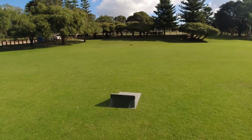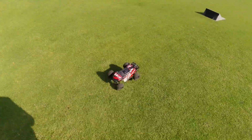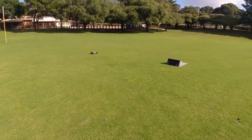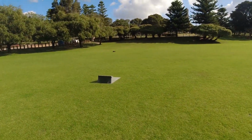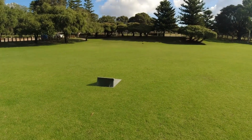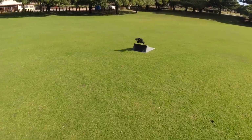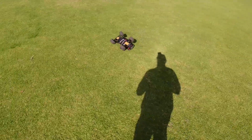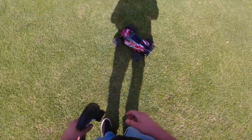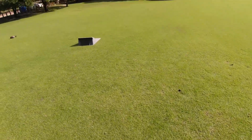The shock's just a guide, nothing special. You can't put oil in them, obviously. They got no seals or diaphragms, but I did fill them up with grease. So that seemed to help dampen the bumps a bit better. It's not going to be like oil-filled shocks, but I don't really think this car is worth putting that sort of stuff on anyway. Just run it as is.